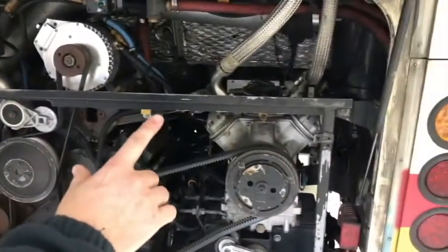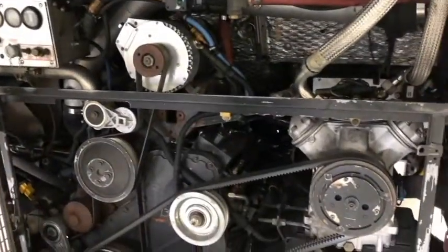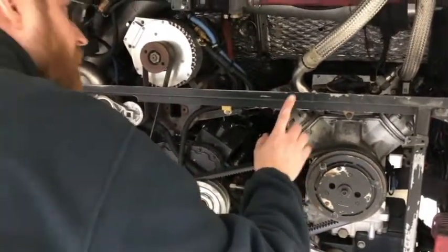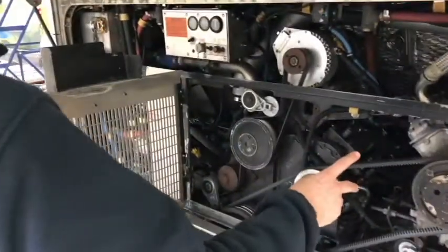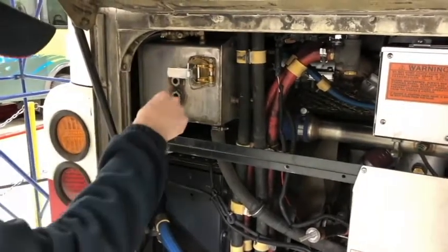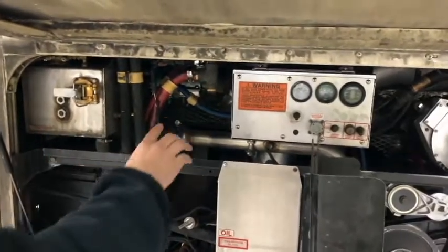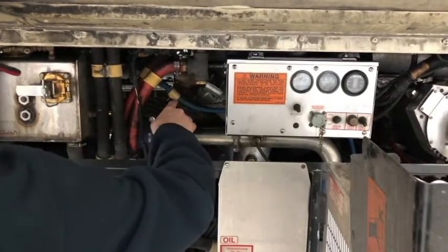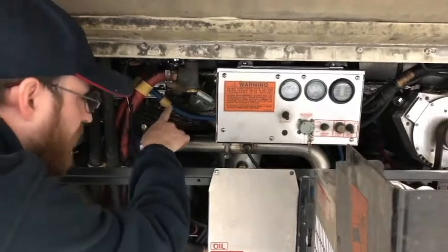For the back of the bus, I will look for puddles on the ground or for dripping fluids on the underside of the engine or transmission. I will check all the hoses in the engine compartment and note that none of them are bulging, cut, cracked or frayed — they are not damaged, not rubbing or touching on any other components, and they are not leaking. The coolant level I would check here. It's in the proper operational limits and the cap is secure, not damaged, not leaking. The exhaust system is securely mounted and tightly connected. There are no severe dents, cracks or holes, and there are no signs of exhaust leaks, such as rust or carbon soot.